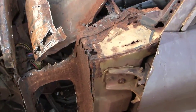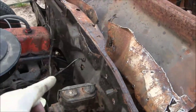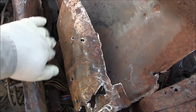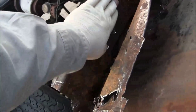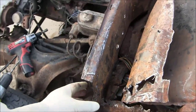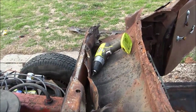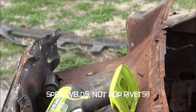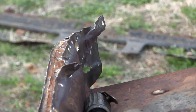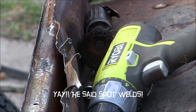Okay, part two. I am ready to pull this out - had to remove the windshield wiper motor. You can see the number of spot welds that were in this panel here up against the firewall, where I've drilled them out. I tried to drill and chisel as much as I could to keep my firewall intact. On the other side, I drilled out all the pop rivets that went along the top of the outer cowl vent, then did the same thing across the top of the firewall, cutting the spot welds and peeling back.